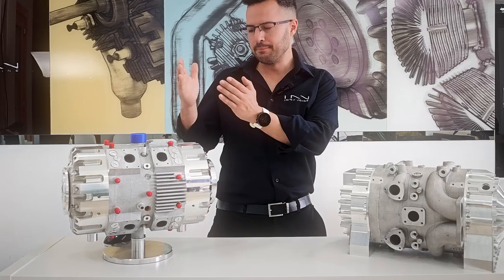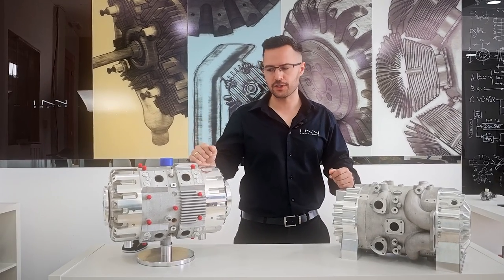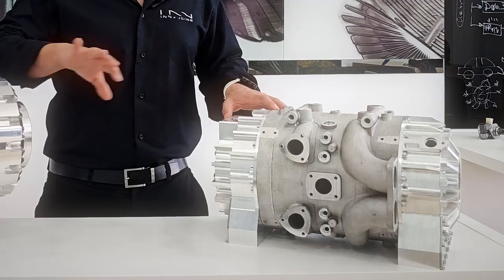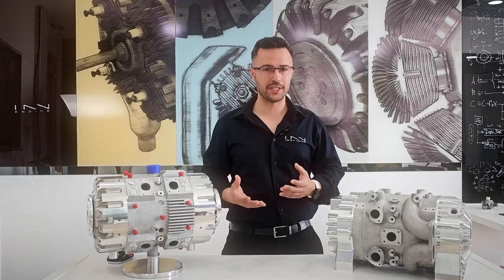There's still a lot more detail we could get into, but I think you get the idea — it's not just a simple matter of going from 500cc to 700cc. These two share the same foundational technology, but they are a world apart in terms of advancement. We are really looking forward to testing our new game changer. On the previous version, we were more focused on mechanical aspects and durability; now, with those behind us, we will focus on homologation for emissions and optimization of consumption. We are convinced our new E-REX represents a massive leap in ultra-efficient power generation for both range-extended vehicles and the aeromobility sector.